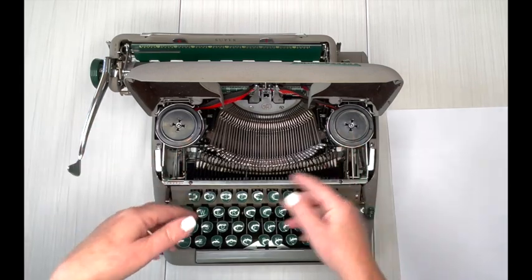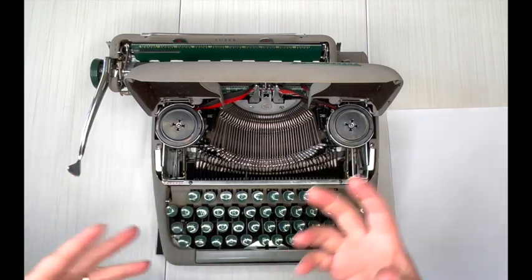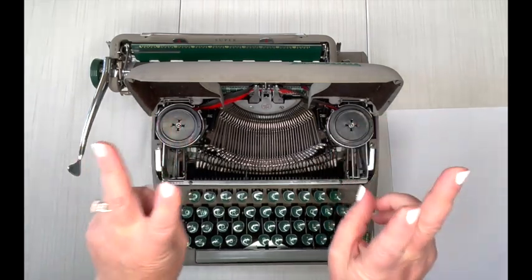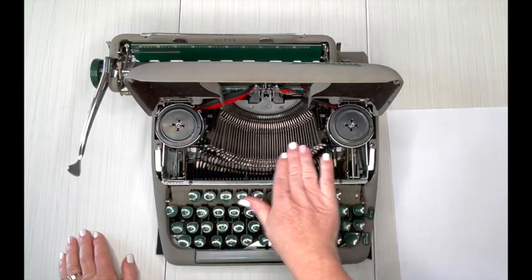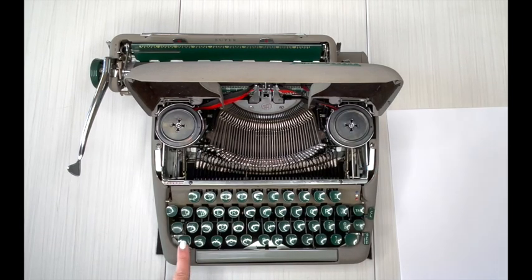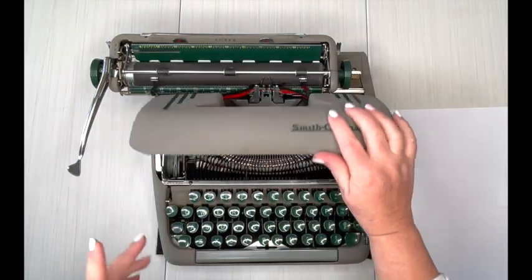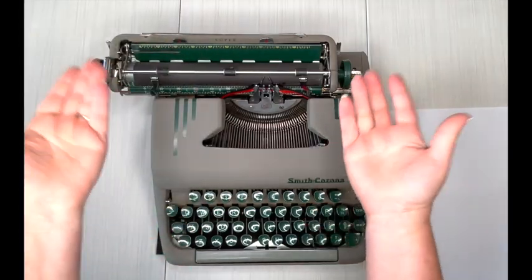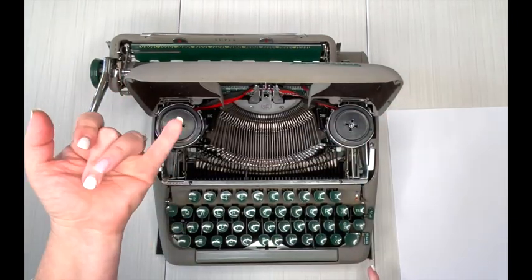Inside we have metal spools, which means we wrapped extra ribbon on this — it's like getting an extra ribbon spool with the typewriter. Normally universal ribbon spools have about 20 feet; this will have anywhere between 48 and 50 feet, so you get double the ribbon. This is your escapement in here, and you'll see it says 'floating shift.' That means when you hit your shift button, this escapement area moves, versus on older typewriters where the carriage would move. The benefit is it's much lighter and more pinky-friendly.